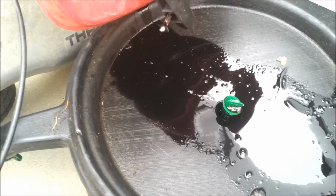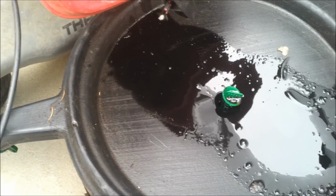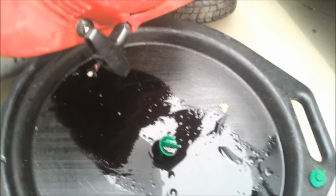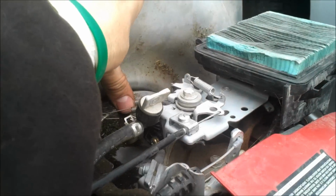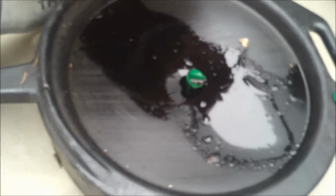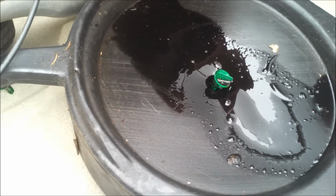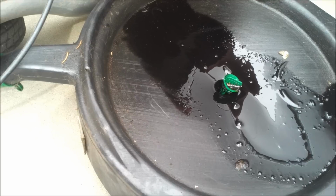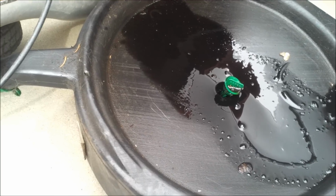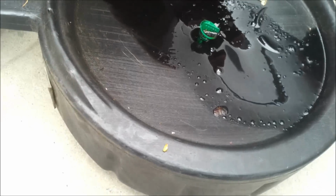If it's in a mower, mow with it. Do a full mow before you change your oil. Like if it's in a riding mower, especially riding, because they have a lot of oil. It's just important to preheat the oil. I always touch the bottom of the block as well, like the part that actually connects to the deck. You touch that and it's pretty hot, then your oil's hot as well. If it's cold or cool or barely warm, that's just the temperature of your oil. Top of the block's always going to be warmer. Bottom of your block is going to be the same temperature as your oil. Once it gets hot and it's getting pretty warm to touch, I let it run for about 2 more minutes and then drain it.